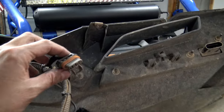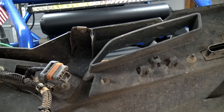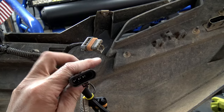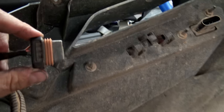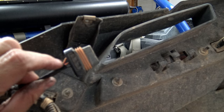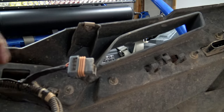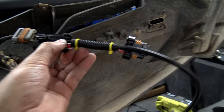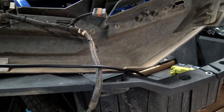I've got the bumper off so we can look at the wiring. This right here is pre-wired for the third brake light on an XP Turbo Razor. After splicing the wires together, this plug conveniently plugs right into that. I've already tested which wires go where — you've got a hot, a brake, and a ground — which matches how we've got this wired. So to power the whip lights I just plug this in, mount the controller, and run the wires to where the lights will go.